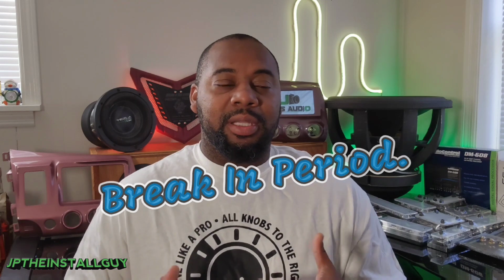Now, that break-in period is literally just allowing that sub to move enough to where those spiders and all that stuff actually gets a little bit loose. Once it gets loose, you can literally hear the difference inside the vehicle once your sub is broken in. Not to say that your sub is not going to play nice while it's not broken in, because they're designed to play. But something that's stiff versus when that suspension is a lot looser, it will sound like a day and night difference once it gets broken in. Might be able to handle a little bit more power as well.